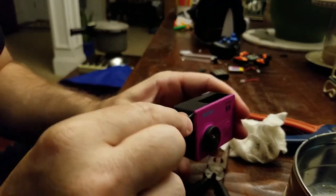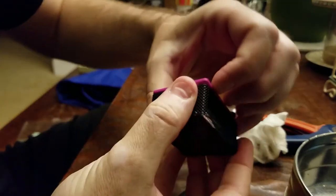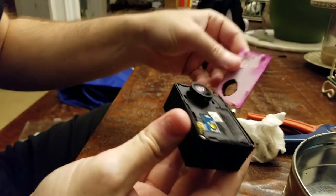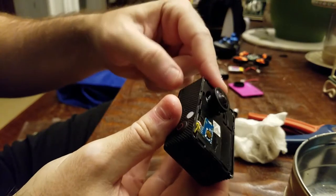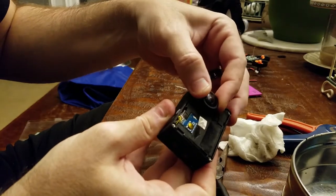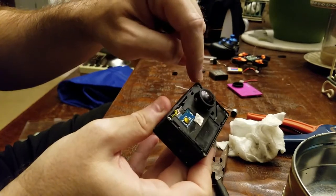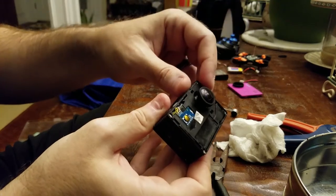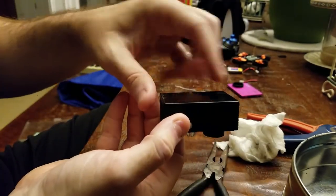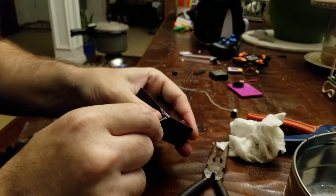You just pry — normally start at a corner. Just pry up and pry around. The glue will dissolve and you can twist it, then re-glue it to make sure you find focus. There are four screws inside here: one, two, three, four. That's it. And there's an LCD on the back that you have to pull off and disconnect — there's a screen, so don't damage it. I actually left the protector on it because I don't watch that screen very much.